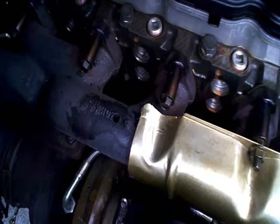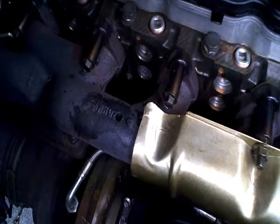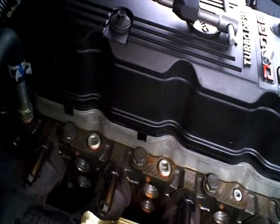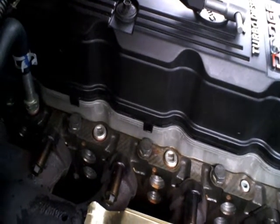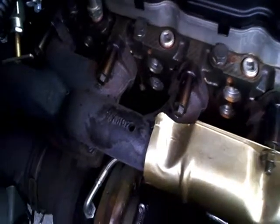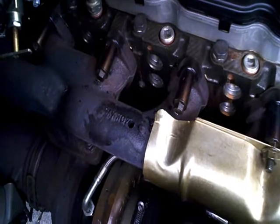Once it's broken through the inner layer, you don't want to blow the chips into the engine, so just pick it up with a pickup. Next we'll be taking the tap and cutting some threads into the hole using grease the same way. You'll want a fairly small magnetic pickup, or make sure you have one that will go down that hole.